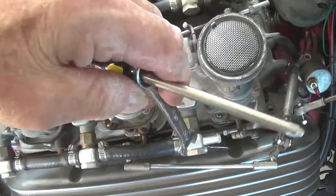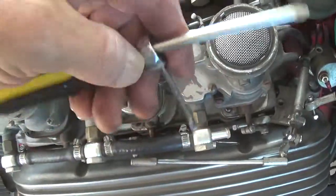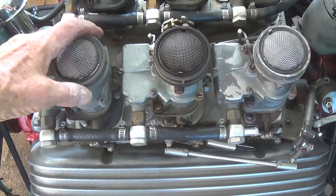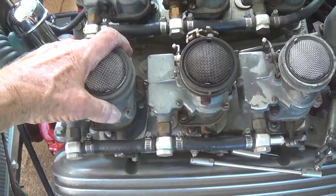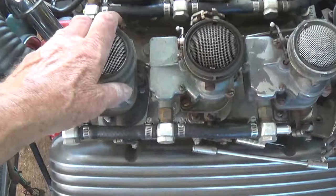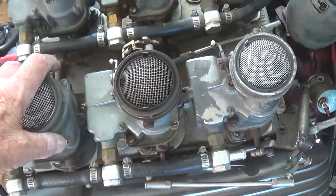I got it using the old vertical wrench with screwdriver technique. All nine nuts have been removed, and against all expectation, all three carburetors are loose and ready to lift off. I won't have to use thermite and a seven-foot breaker bar to try to get these things loose.